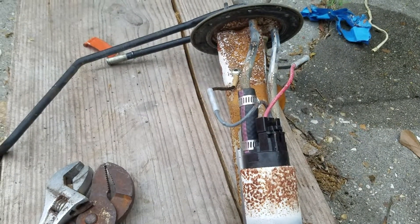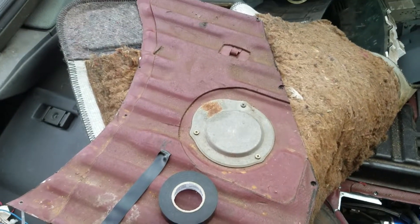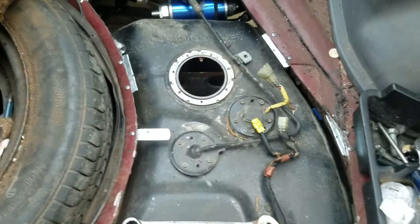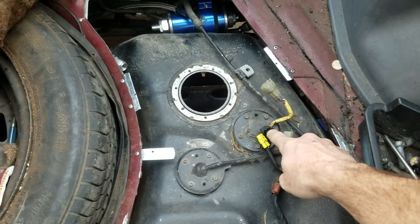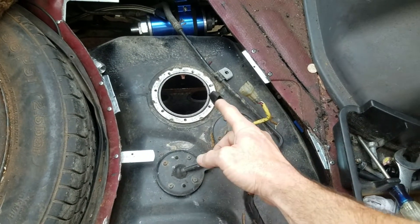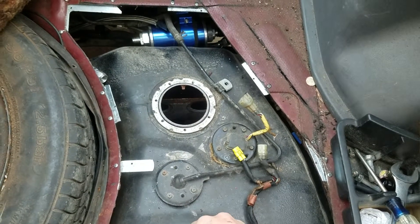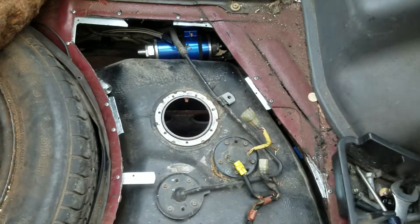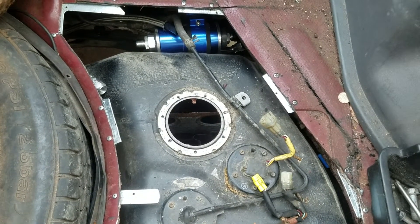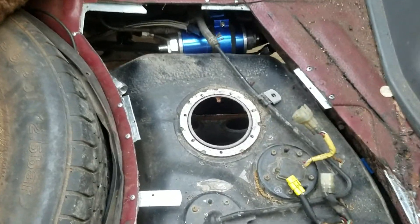I'll show you what I did to get to this without spending an hour taking the tank off. Using a cutoff wheel, I cut this piece out of the back under the hatchback to get to the sender and all these other deals. This is for your fuel sender to tell you how much fuel you've got for your gauge, this is for the charcoal canister for fumes, and you can see my fuel filter — that's a stainless 40 micron reusable filter I put in there rather than getting up under the axle every time to change it.